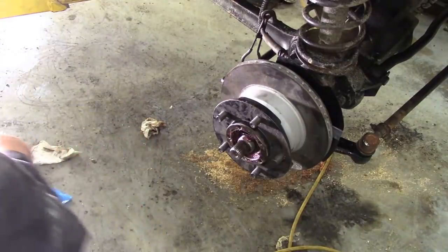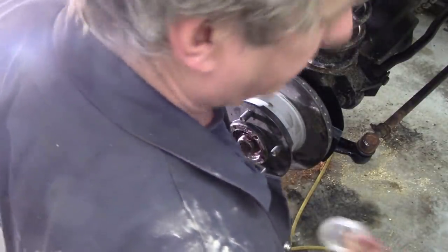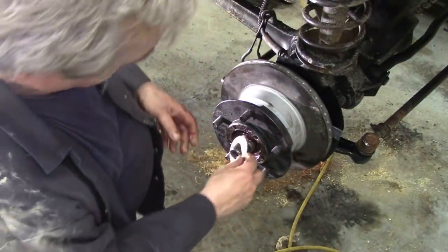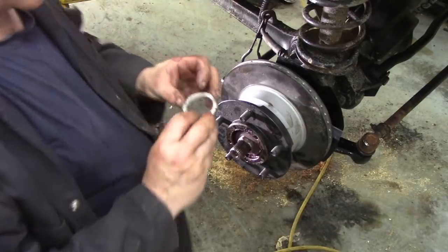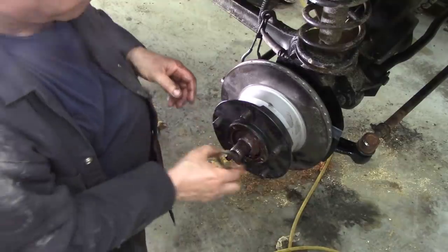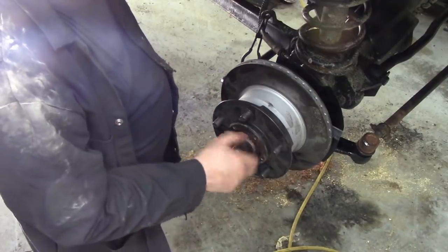It's lovely, that. Some people get all excited about turning it back 90 degrees and doing this, that, the other. No need. Bit of grease on the washer. This is to aid friction, or rather, to get rid of friction, when we put the other nut on. Pick our nut. Now we're going to pick the best side of this nut, even though I've ground it off, so the nice flat side goes to the tab washer. Screw it on.